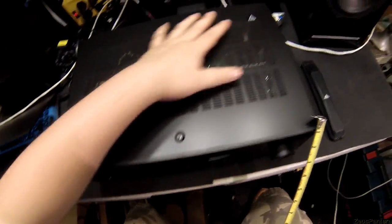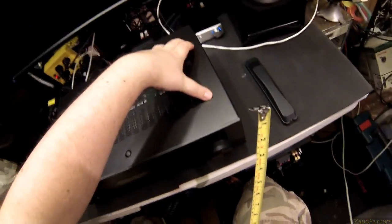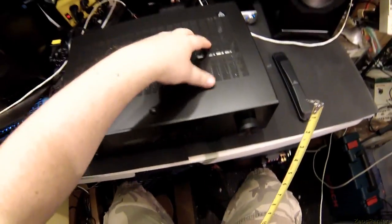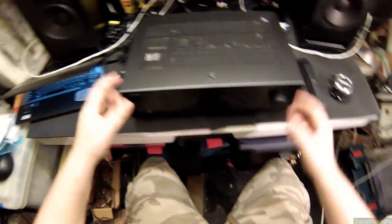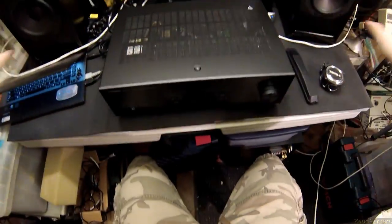Now, don't think you're going to put your monitor on this or anything else that's going to cover these vents. These pretty vents. See? I think that's a warning symbol for heat rising, because you're going to damage something. If you do want to put your monitor on this, it isn't the best metal. It's a little chintzy, and then add several hundred holes to it, and the little chintzy becomes flexible. But if you're going to put this on your desk, you're either going to have it to the side or have to build a little table thing. I'm sure IKEA has something. You need about 1.5 inches to 2 inches just to allow air to go in the sides from the bottom and convect out.